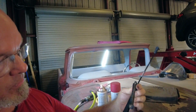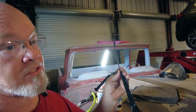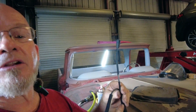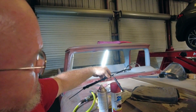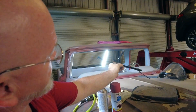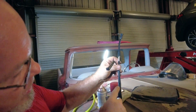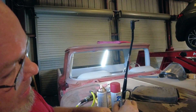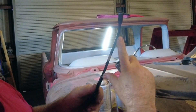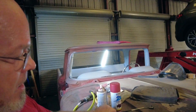These actually give you way more tension on the windshield than the original ones. The bigger problem is the aftermarket replicas don't have quite the tension on the blade that they're supposed to. The only problem with the 83 to 95 Jeep Cherokee rear wipers is they only have a left side — you see how the blade faces up, it's going to go on the windshield that way. If I put it on the other side it's going to face the wrong way, so I'm going to cut it and weld it after flipping it over. It doesn't really matter where you cut it as long as it's on a straight section of the wiper arm, so that when you flip it over it's still going to be straight.